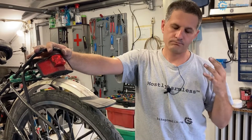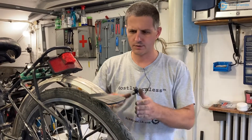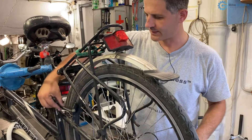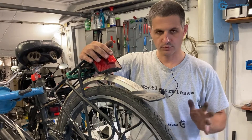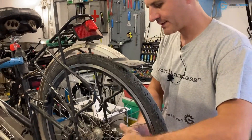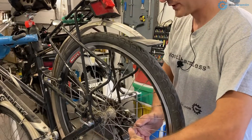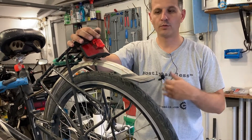This is what I call a quick and dirty way to true a bicycle wheel. It's always easier — and perhaps a bit more precise — to do it in a truing stand where you can see more clearly. I usually use zip ties rather than just the brake pads because I can set the zip ties to whatever distance is perfect for the phase I'm in. If you want to just quickly get back on the road and don't have a tension meter, you can use a guitar tuner app or your fingers to sense if some spokes are very loose or too tight and get the wheel back to decent shape.